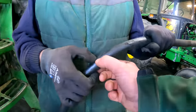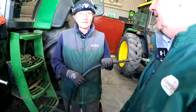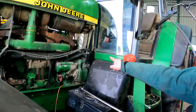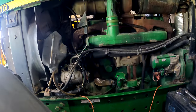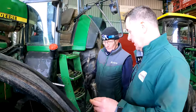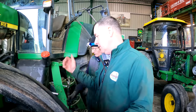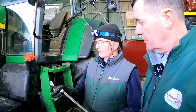The leak was right at that spot on the pipe. Now it looks simple enough — until you try to get it out. That pipe starts from back underneath the cab, runs the whole way down the chassis rail, right up under the radiator and back up into the oil cooler. It wasn't leaking an awful lot, but we decided to take it out. We thought about joining it in place, but there are a couple of pipes beside it. We tried welded spanners, we tried everything — it's buried in there.